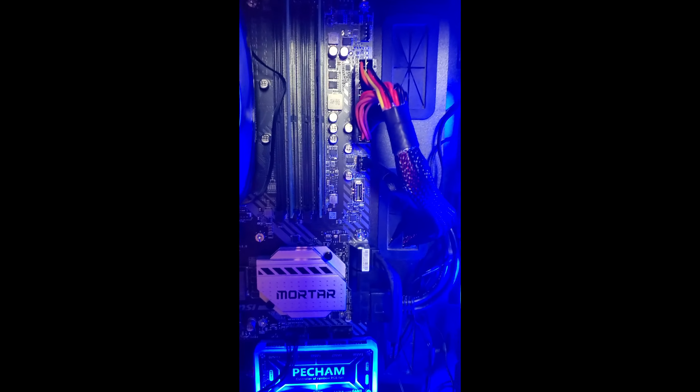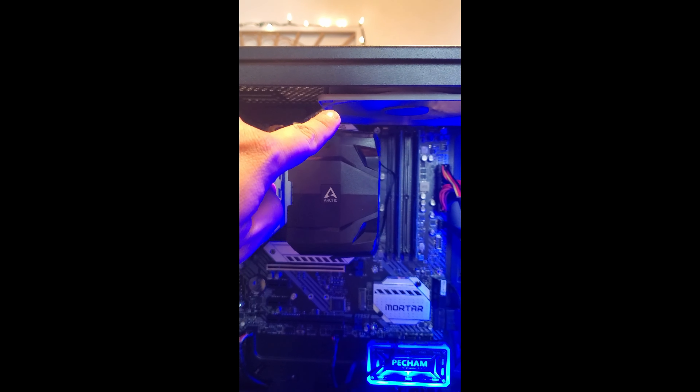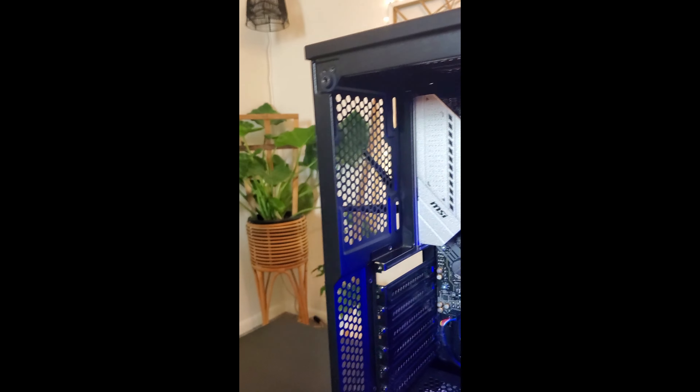I already talked about the CPU cooler, the memory I pulled from my old computer, the storage I pulled from my old computer. Here's another problem — this fan up here is the Noctua Redux 140 millimeter fan. This fan does not fit in this case very well in the position I put it in, because I wanted it for top ventilation. I wanted it in the back of the case, but look at where the CPU plugs in — this fan was in the way of the CPU plug, so I couldn't even plug in my CPU. I had to shift this fan over. So actually this fan that's venting out of the case is really close to the front, which is probably not even doing a whole lot. It's supposed to be in the back. So I'm probably going to have to add another 120 millimeter fan back here because 140 won't fit on this slot. The Noctua Redux is a really good fan — it just doesn't fit in this particular case.